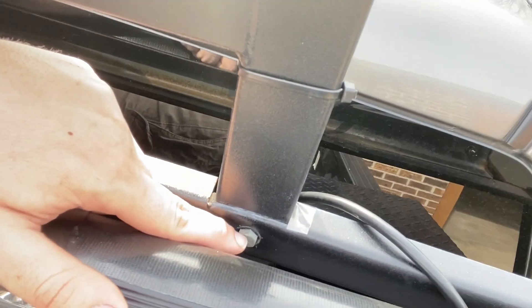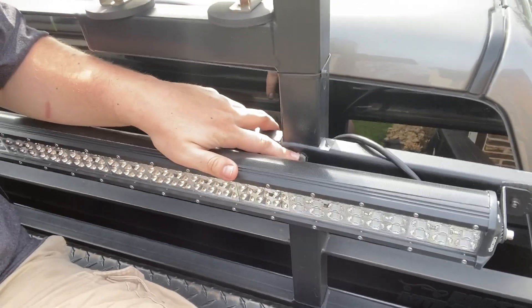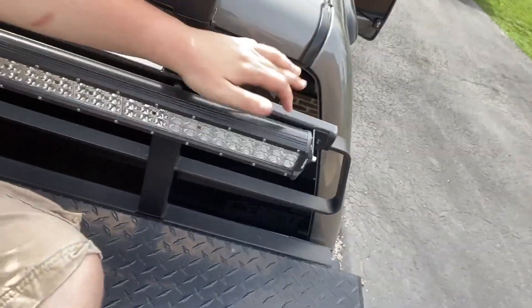You can see right here it's screwed in. We had to drill a hole out and install something called a riv nut. It basically goes into metal like a rivet — it expands in the metal so it doesn't come out, but it leaves you a threaded hole to screw into. I put a riv nut in there, the screw threads right in, and I painted this with bed liner — it was originally blue.